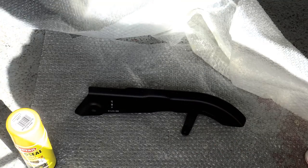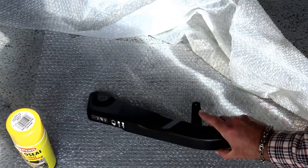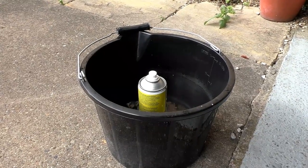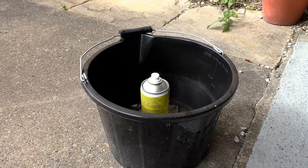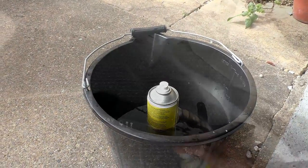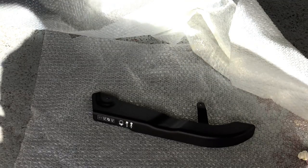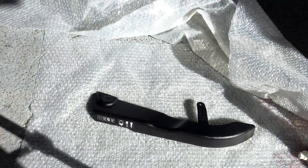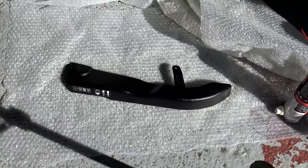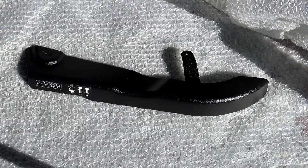Unfortunately on the day of filming we had rain and the temperature had dropped severely. If this is the case for you, fill a bucket with hot water from the tap — hand-hot — and leave the can in that bucket for about 15 minutes, taking it out regularly and giving it a good shake to make sure the liquid is evenly warmed through. Wax Oil is also great for rust-proofing parts you're putting into storage. Spray light, even coats — just wet the surface; don't go on too thick. Less is more.